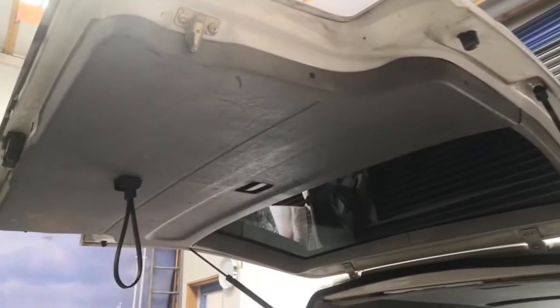I'm going to start by taking this handle off — it just slides up and then it should just fall off like that. Obviously this is on the tailgate; I don't know if it's the same for barn doors or similar. I'm going to take this handle off next and then undo the screws that go around the outside of the rear door card. There's one there and one there, same on both sides. I'll take that off and then we're on to the next step.